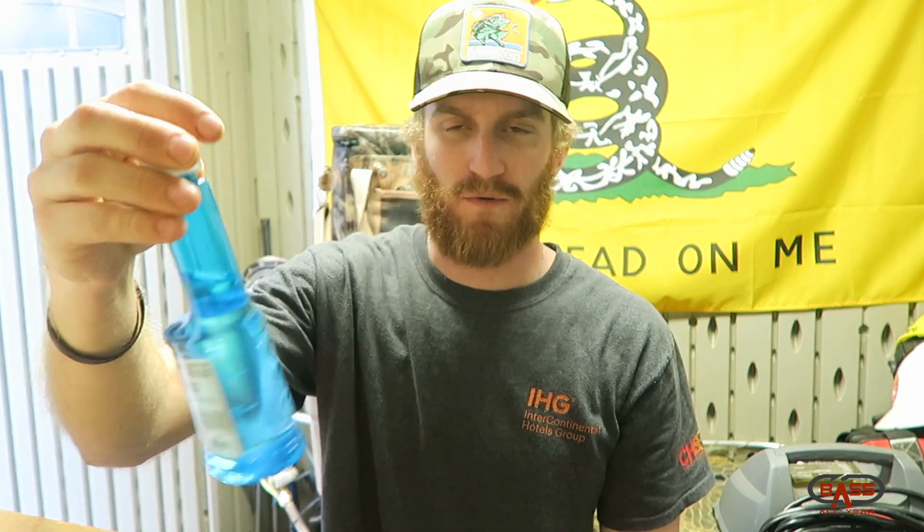Now you've got a better understanding of changing lower unit oil on early-to-mid 2000s Mercury outboards. It's a super cheap, easy job you can knock out in 10 to 15 minutes for about 15 bucks - ten dollars for the oil and five for the pump. Changing the lower unit is also part of your annual service, so if you take it to a shop it'll get done anyway, but it's important to keep up with it through the year at those 20-hour intervals. Being a two-stroke guy, the only oil I change is that lower unit oil, and I also run Startron enzyme fuel treatment throughout the year.